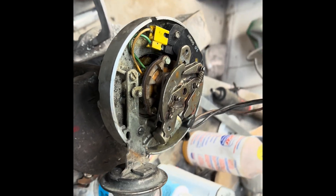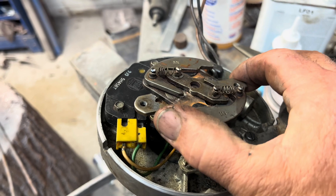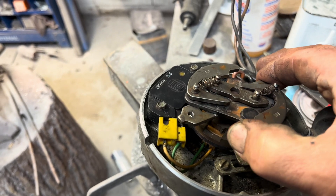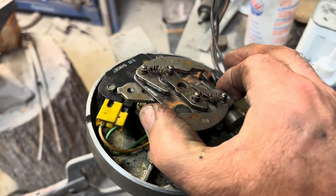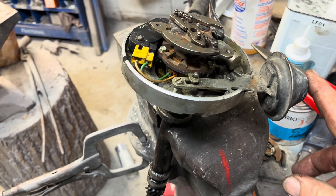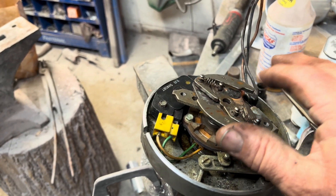If it's too tight I'll either put a lighter spring in or just stretch these bad boys a little bit. I welded up apparently the wrong side of the notch, so now I'm stretching my spring quite a bit. It felt a little tight so I went ahead and stretched the spring until it was just short of popping onto the dowel — just about like they are original. I may use the vacuum advance, I may not — I'm going to see what the motor likes. Having lots of timing at high vacuum doesn't do any harm, it won't spark knock, and the engine will run a little cheaper and cleaner. This is my fix; works good for me.